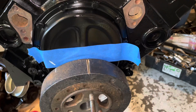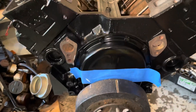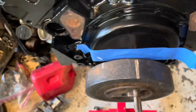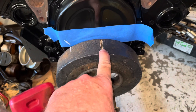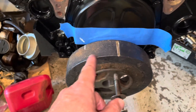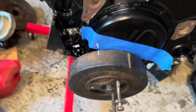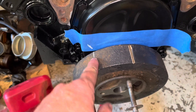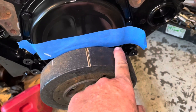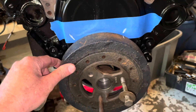I've redone this, put new tape across the front, and rotated the engine clockwise with the stop in the cylinder. That stopped the engine rotating right here - approximately where I had made a mark last time. This time I also made a mark on the harmonic balancer as a temporary reference mark right here and marked the tape with the same line. Now I'm going to rotate back the other direction, and this mark should come up somewhere over here.